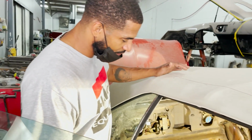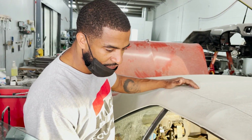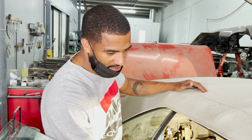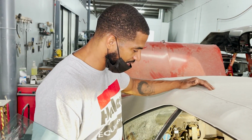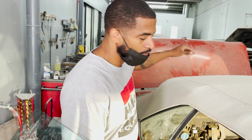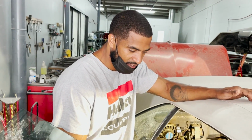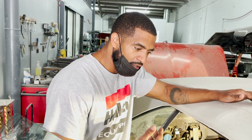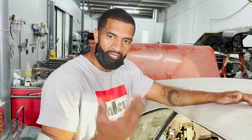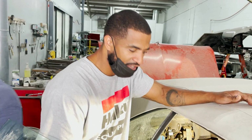A lot of the cars that we got are convertibles, so they have a lot of rust on the floor, moisture getting in, a couple different reasons. The evaporator might be leaking, that starts corrosion, whatever it is. We went over with Mr. Lofton's car, the 72, that they have patch pans, which we ordered. We're waiting for them to come in for this car as well. When Chris brought his car, he had the patch pans already ordered, so we just went ahead and tackled them. That's how we got on that one immediately. We're ordering for this car, we're waiting for them to come in.